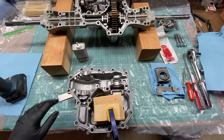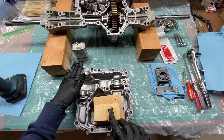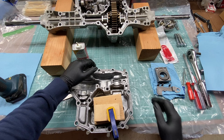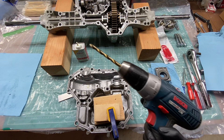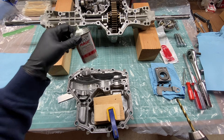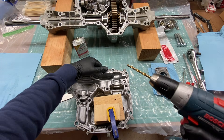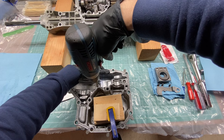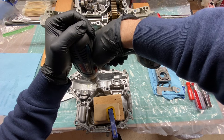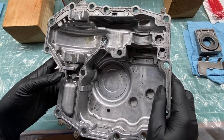I'm going to drill my first drain plug now. I've shimmed my case so it's flat on my workbench and put some wood inside to help clamp it to the bench to steady it. I'm using a 17/64th drill bit with a little bit of cutting fluid to help guide the bit through the material. If you're going to install drain plugs, you really need to do your drilling from the inside of the case. I would highly discourage attempting to drill from the outside without taking the trans apart — the chances are pretty high that you will end up with metal chips in your transmission.